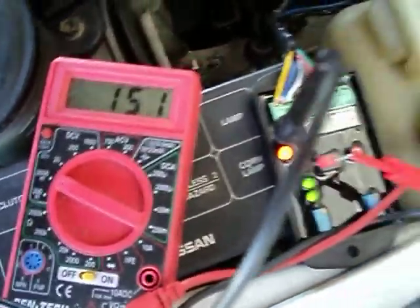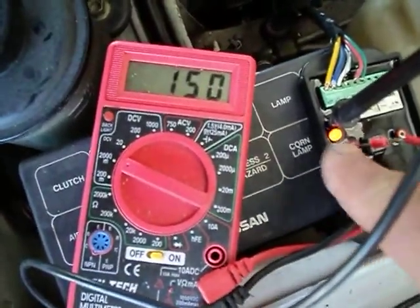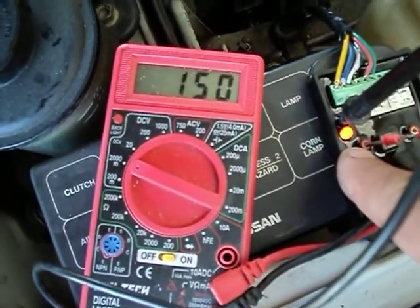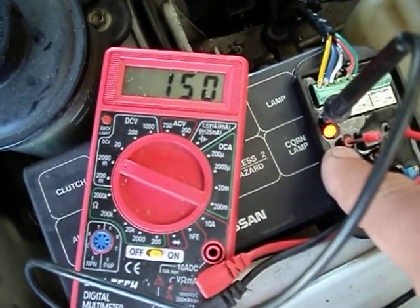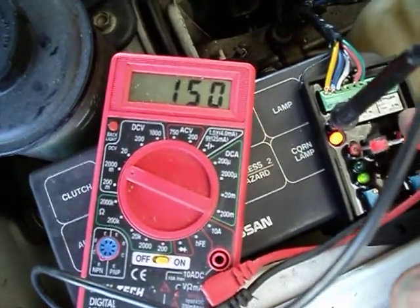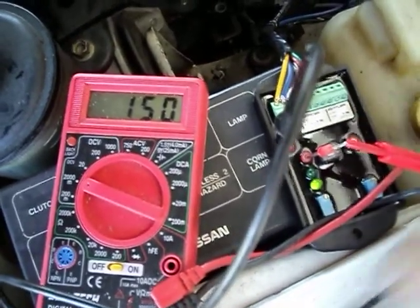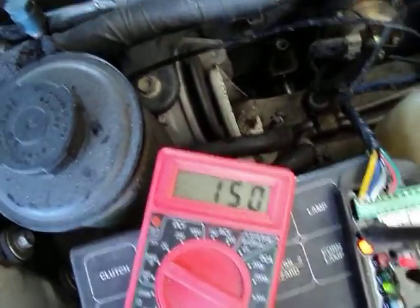I think you'd be very happy with that. You see how I've got this set up — you see the digital reading, right? When you hook your probes, this is the only bank I'm using here. This is for the front two — one on the front bank, one on the back bank of the engine. And this other one is for the rear sensor, which we didn't hook up on this one. So we're just modulating the frequency of the first one.